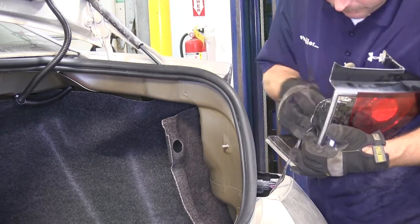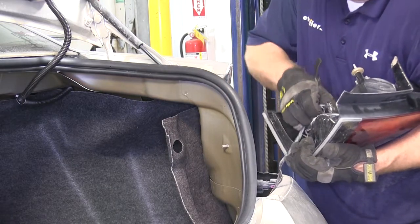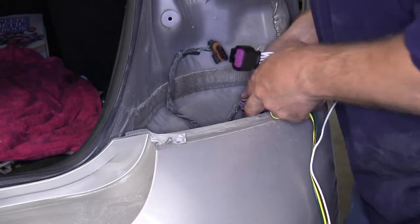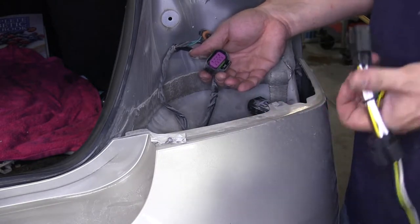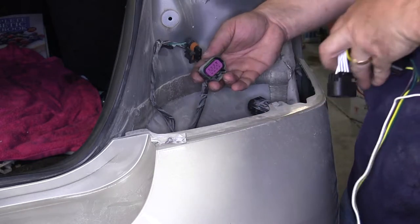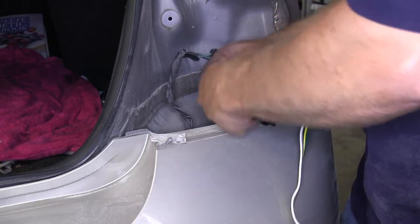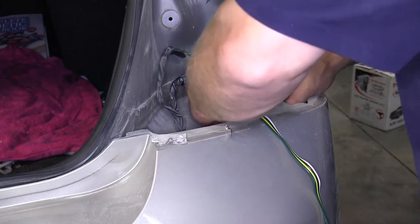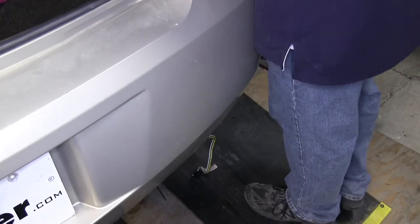With the light out, to make things a little easier, we'll disconnect the wiring from the back of the light assembly. You will notice there's another plug that is plugged in right at the rear bumper fascia. This is actually the plug that we'll be connecting our T1 connection in with. To remove this, you'll go ahead and squeeze the locking tab on the plug and pull outward. Then you'll line up the male and female end on the new plug with the existing plug, making sure when you push them together that they snap into place. Now we'll go ahead and drop the four flat down behind the bumper fascia so it comes out the bottom.